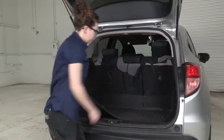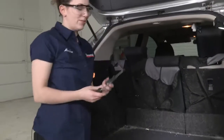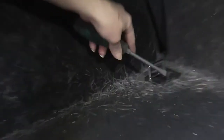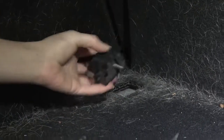So we have a few pieces we need to remove. We've got this rubber floor cover here we're going to take out. Next we're going to remove this floor panel here. You'll need a Phillips screwdriver and a flathead screwdriver. As you see in here there are these little metal clips. We're going to flip those up, stick your flathead into the end there. You'll feel a notch and that panel will pop up to reveal the Phillips screw that we can remove now. Just remove that screw and this piece will come right out.